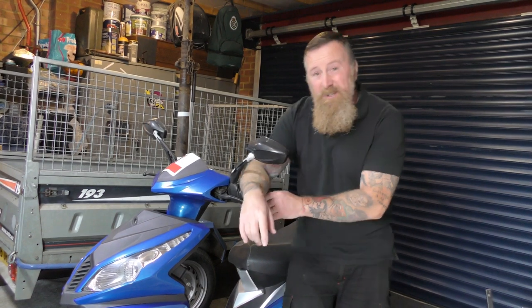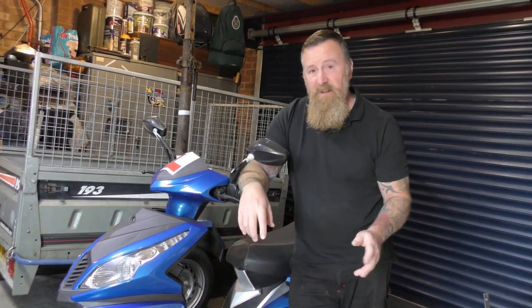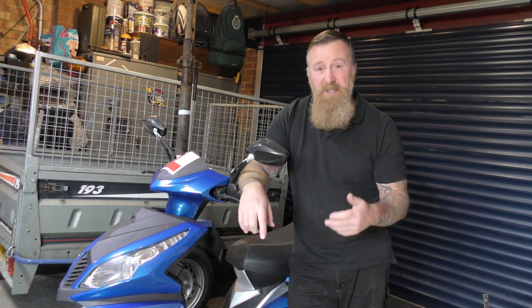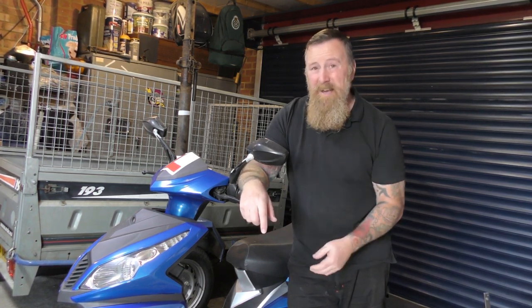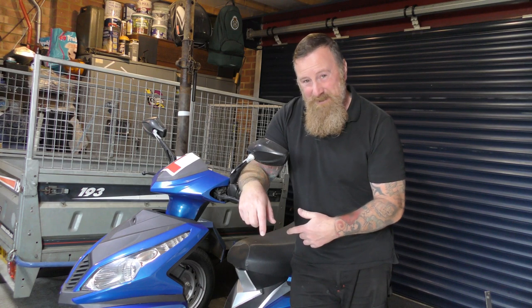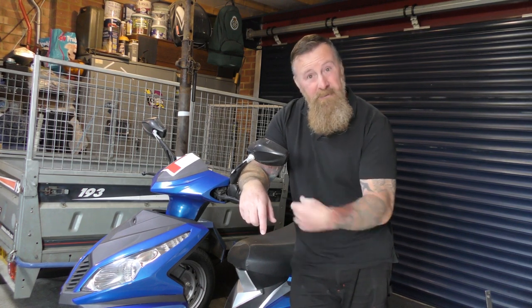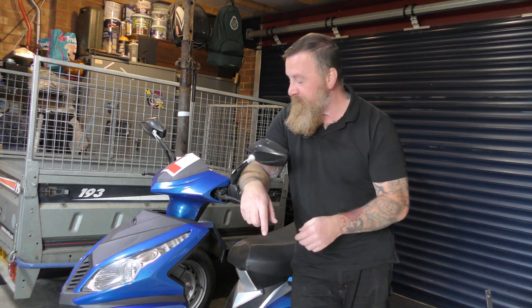Engine. These are four strokes. Oil change - it's got to be done. Every couple of thousand miles on these, it's just worth doing. And it's only a litre of oil anyway. Quality 10W40 motorbike oil. Doesn't really matter in these if I'm really honest with you - what they put in there is crap. So drain it out at the bottom, no filter, make sure it all comes out, put new in. That will help the engine and the longevity of it.